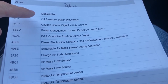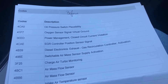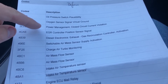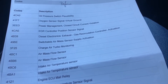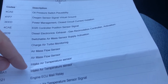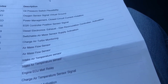As we can see, there are a couple on there which I knew about, and some of these might be old — I've had the battery off so some may even be related to that. Oil pressure switch — I know that's always coming up. Oxygen sensor — we know I had that replaced. There's one for the EGR valve, which could still be an issue. And then there are some more for the air mass sensor, flow sensor, and air intake sensor. These are all things I've had disconnected, so I'm not 100% sure whether they relate to actual issues.